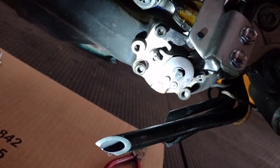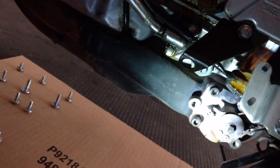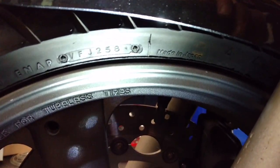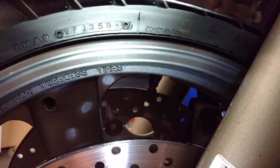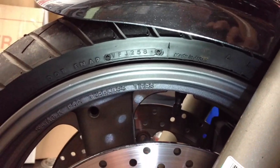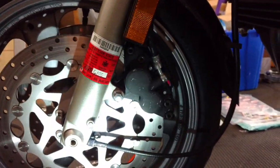There's a very excellent service guide that I'll link in the description. I also realized my inspection was slightly overdue. The date code on the tires is a three-digit numeric code — that means these are pre-2000 tires. The rear has the same situation, so I've got tires from 1998 and 1999 on this bike. Far too old. So: new tires, new brake lines, and I'll be good to go.